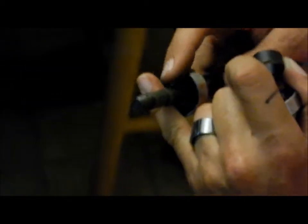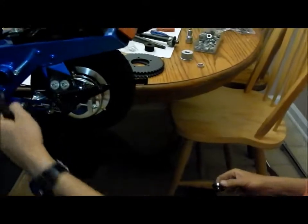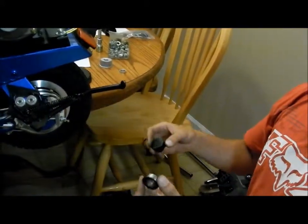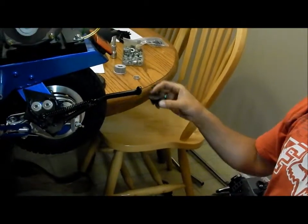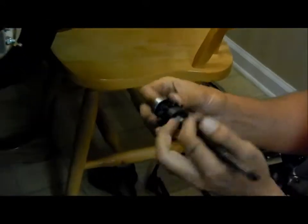That spacer takes up the space between the bearing and sprocket, sandwiching everything down so the bearing turns with the shaft. You also have the option of going with a Type 3 spacer — once you get the snap ring in on a new Cobra Rock type or Cobra Commuter model, you add a short spacer, then a second bearing, and then your pulley. Those are the two options for spacers: Type 1 or Type 3 with an extra bearing.